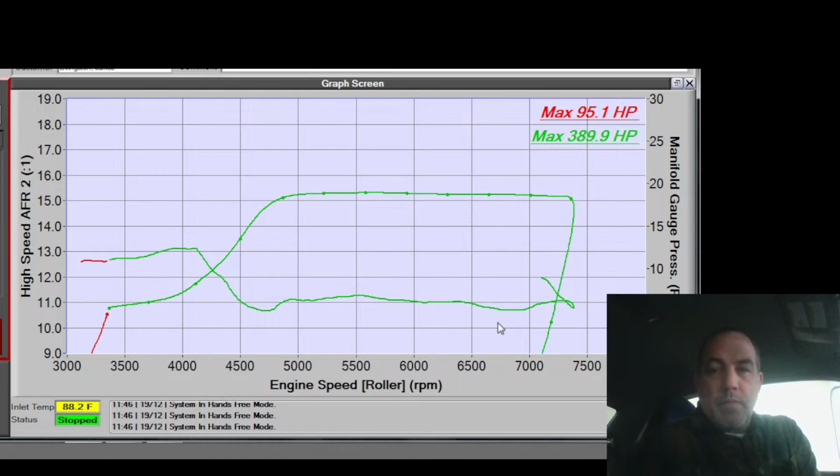For the Subaru, yeah. In this case, because we're running speed density, well, in all cases, whenever I can, I put the IAT sensor post intercooler. I do it on all the cars: MAF control, top mount, front mount, whatever. Especially top mount cars, since the top mount is so unpredictable and so subject to heat soak from engine bay temperatures. I always move the intake air temp into the intercooler. It's the best thing you can do to keep an STI engine alive. Post intercooler, right on the end tank, right in front of the throttle body on the bottom, we just drill and tap an IAT sensor right there. Feed that to the ECU, and that adjusts timing based on actual charge temp. If you want to do anything to save a 257 from blowing ring land on cylinder 4, that's number one.